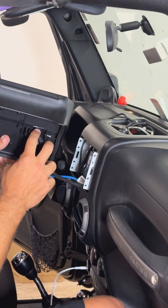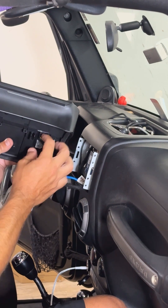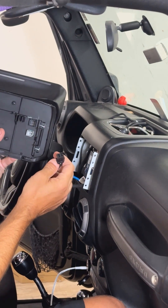This one you might need to remove some plastic in here. We've already cut this one out. If not, you could take a flathead screwdriver, run up in here, and push down on this locking tab to get that cable disconnected.